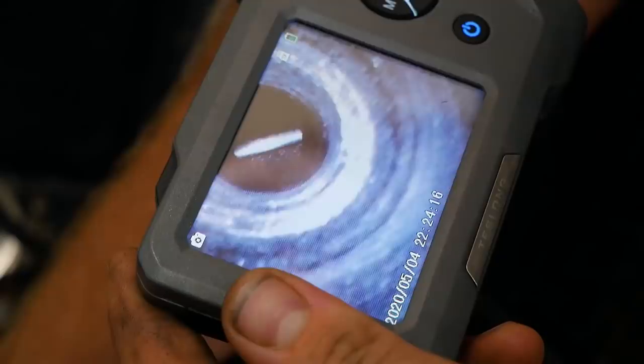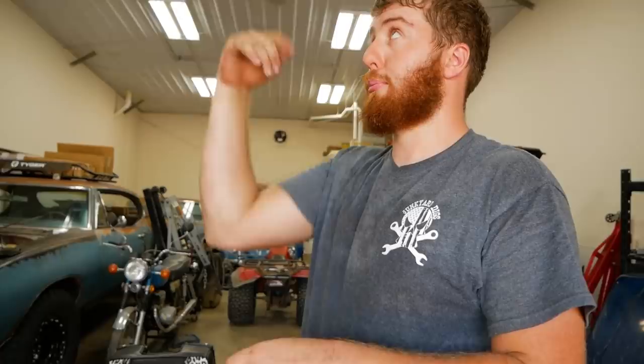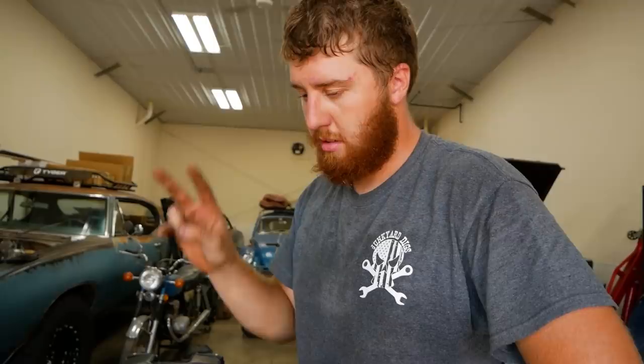Well, this just turned into a longer video. Yes. Alright. Now that we put our belt back on, it's immediately back off. We're gonna actually pull this engine out to put a helicoil in it, because then we can flip it upside down because there's no oil or anything, and just with the air gun get all the metal out of the combustion chamber. Done. Okay.